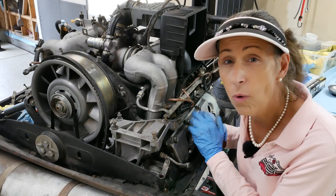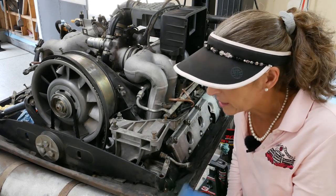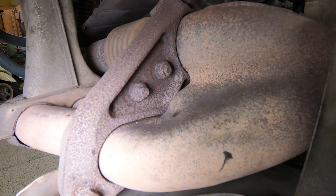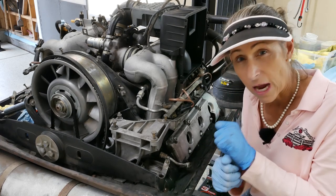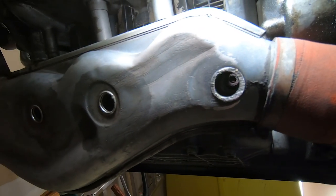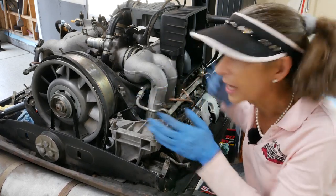Since we have the engine out, I do want to refresh several things. We've got hoses I want to replace, fuel lines and things that are very difficult to get to with the intake manifold on. I also want to get the exhaust off because I want to get a lot of this bit powder coated. I've been soaking the exhaust bolts with PB Blaster because they're seriously rusted. I'm also waiting on some very long 8mm hex socket adapters because you have to come in from underneath and through the heat exchangers to get to the exhaust manifold bolts. I think we can start taking off some of the intake manifold — it's best to take the whole thing off as one piece.